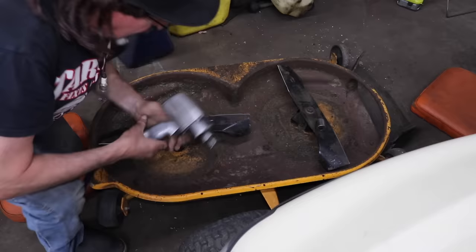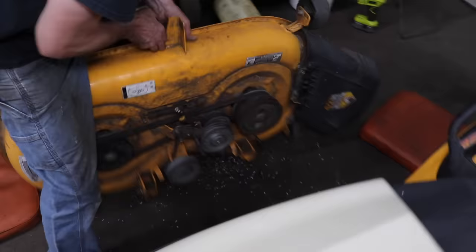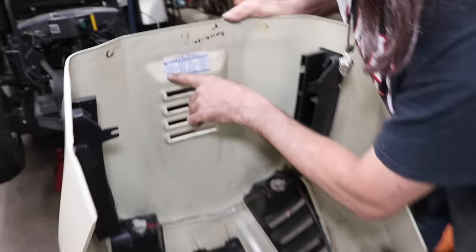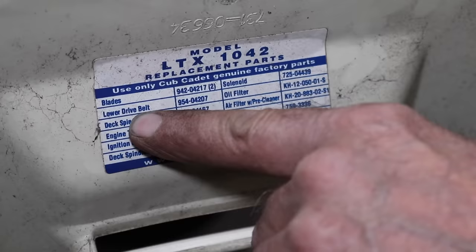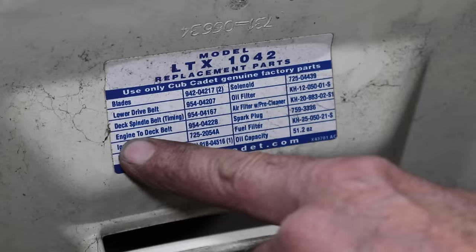Alright, so now we can put a new belt on it, because the mower runs like a top. So under the hood, engine to deck belt, that's what we want. There's the deck spindle belt, there's the timing belt, and the lower drive belt, that's the one from the transmission to the engine. So we want the engine to deck belt,